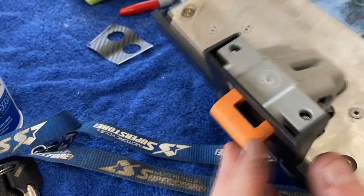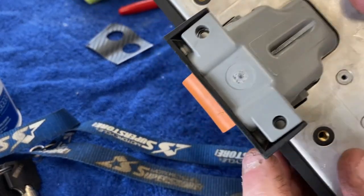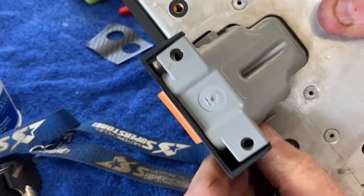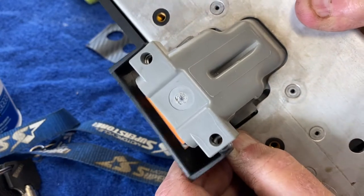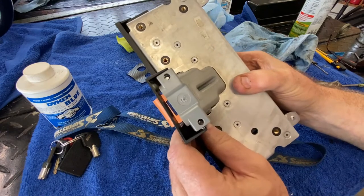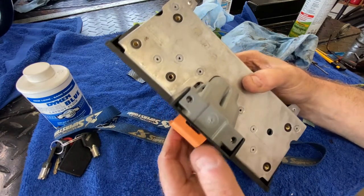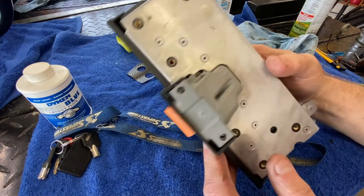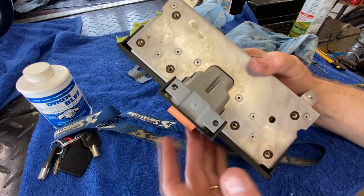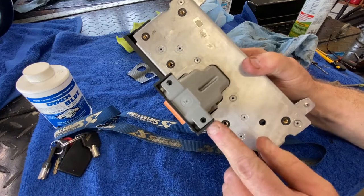By the way folks, there are two little square nuts that go inside here. If you bend this back, these will come out — you can see one poking its head out right there. I wasn't even sure where the other one came from when it fell from this towel, but I had them both. Those are for two of the eight screws total. So just remember if you take this apart: once you get this cover off, put these in a safe place so you can put them back. You can put them back just by spreading that out and shoving them in.